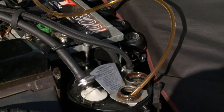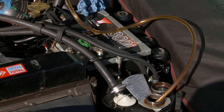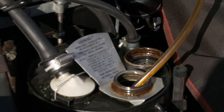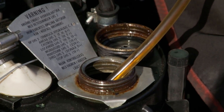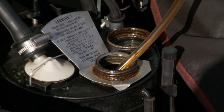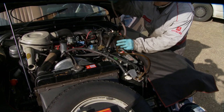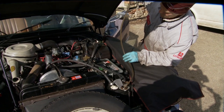Push the brake a little harder. Still there's quite a lot of air coming out of this system. You want to keep flowing brake fluid through until there are no more bubbles you can see in the pipe. As it's circulating, just keep going until it's clear like it is now. Then tighten up the bleed nipple. Use a cloth to mop up any spillage, catch the pipe, lift it up and drain it into the tank. So that's this side done.